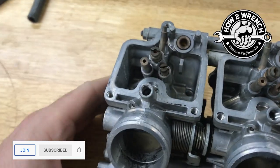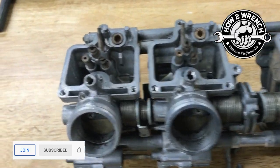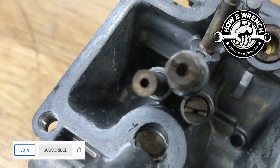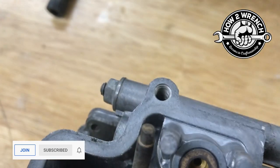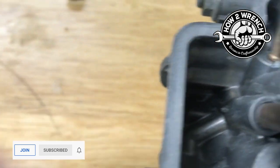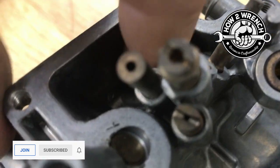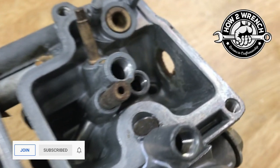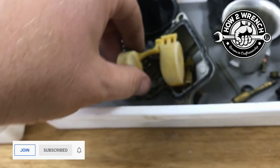This is a pretty unfortunate deal. I really think this is a wrecked motorcycle and something goofy happened — somebody siliconed it. Now that they're apart you can actually see the crack down in there. You can see it's dented in and there's a crack down there. I can feel it with my hand. And then the really bad one there on that throttle position sensor — that's the stud that's cast on there and it just popped out.